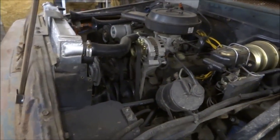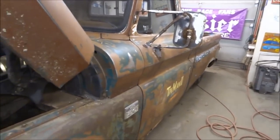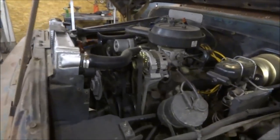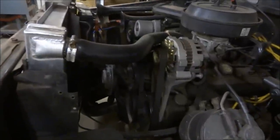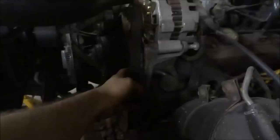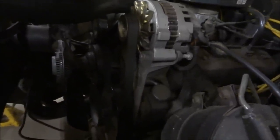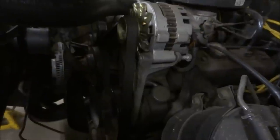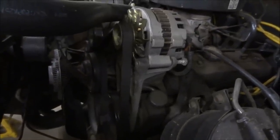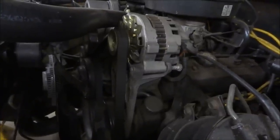So as I showed you guys earlier, I have my compressors underneath the bed back there. I have Viair electric compressors, just a dual 444C setup is the model. But you can actually get engine driven compressors. This at one time had an engine driven compressor over here. It's just a belt-run compressor. They're really nice because as you're driving, it'll actually build up pressure. So you can get a lot bigger tanks and fill up. And then at car shows, you don't have to worry so much about your electric pumps running and running out of air quite as much.